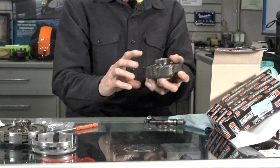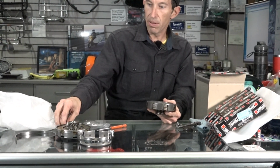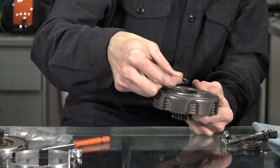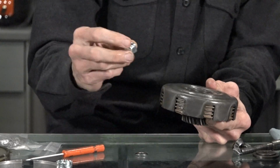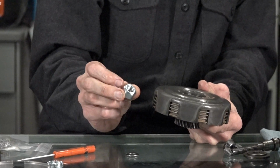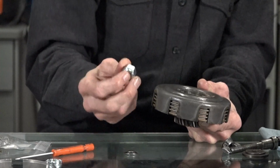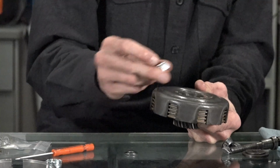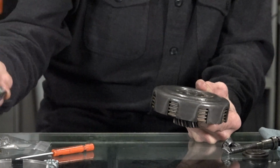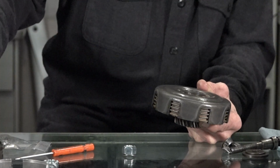Remove the tool. And the way this clutch is attached to the crankshaft is a little different. You don't use this style. There's a wave washer that drops in there. That's actually a little small. It's supposed to be a 12mm wave washer, but there's a specific Piaggio part. And there's this swaged lock nut. You can see it's distorted on the end. Probably want to replace this after you remove it 1 or 2 times, or put red Loctite on it. Again, about 30 foot-pounds, a little easier to use than that original setup. You can't use this newer setup on the older clutches because the inner diameter is much smaller.